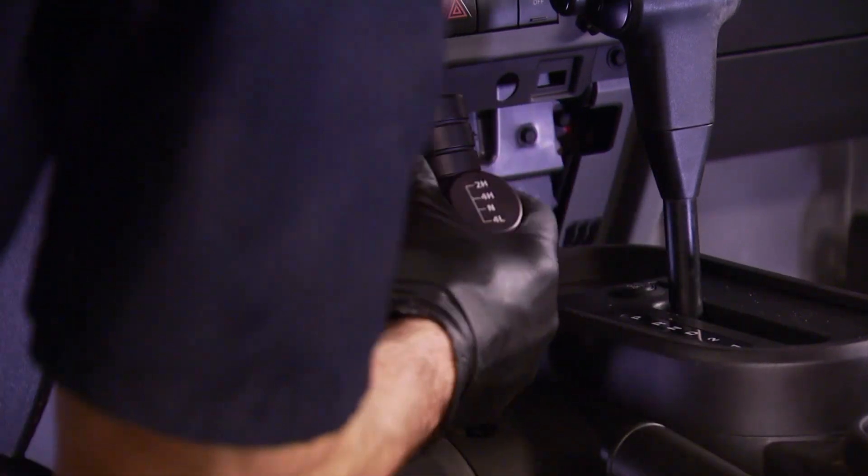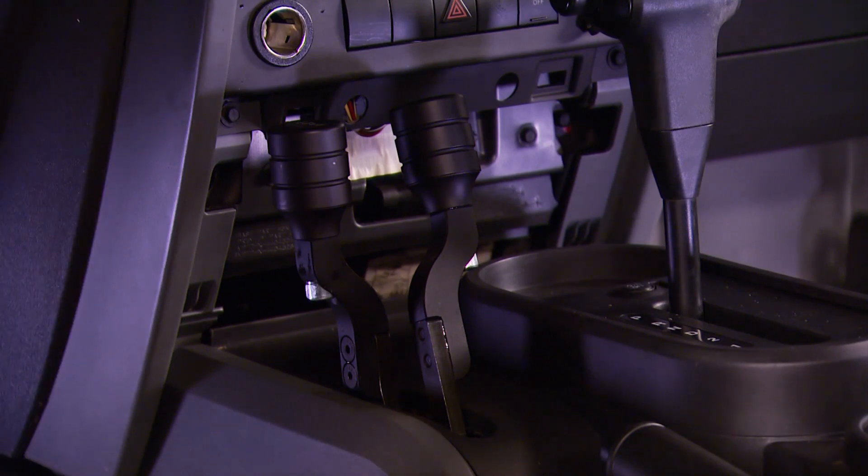Since we started with a two-wheel drive, we're going to have to make a modification to the console trim by converting this coin slot into a hole for the transfer case shifters to stick through. I'm using a razor knife and trying to be really careful. Once the hole is cut open, I'm filing things down to make it look a little bit neater. Then it simply snaps back in place and you can reattach the transmission shifter, and finally reattach your twin-stick shifters. Low range, high range, two-wheel drive all the way forward. Turned out pretty good.